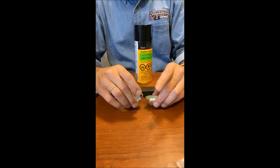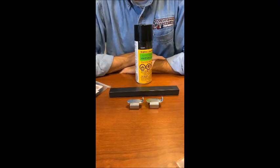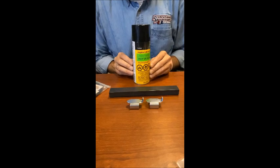The next thing is there is 36 track clips missing off of your 200 snowmobile. Every other one is missing. So when you ride that snowmobile and where the clips are missing, you've got rubber on the Hi-Fax. The hotter it gets, it's like 10 little brake pads every time the track goes around trying to stop the sled.